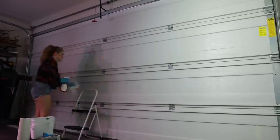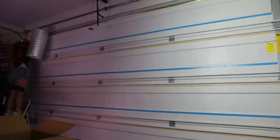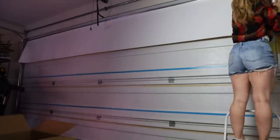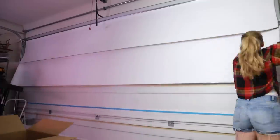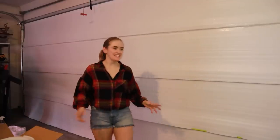First, I have to completely clean the inside of the door. I'm using a degreaser to make sure that wherever the tape is, it's going to be super squeaky clean to keep on my insulation. Now I apply the really heavy duty double-sided tape. The insulation is pre-cut, which is really nice since I'm doing this on my own today. Then I remove the backing on the tape, wait 10 minutes per instructions, and put it into place. I finished! This took me all day — it was just kind of tedious. I love it. I can't wait to see if this impacts not only my heating bill in the winter and makes this space more usable, but also hopefully in the summer I won't roast. Time will tell to see just how effective this is.